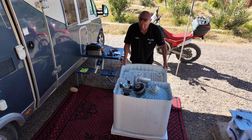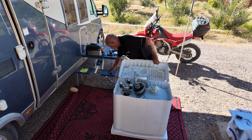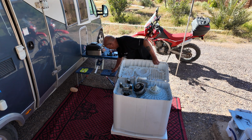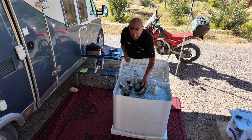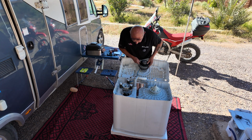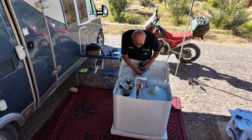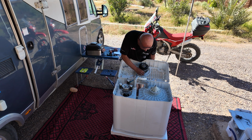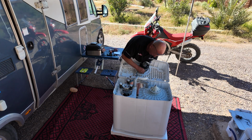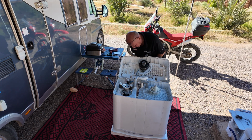Okay, the first thing we want to do is reassemble the machine, and this is quite tricky, especially when you're working on your own. You'll need to get the mounts ready and the bolts, and I suggest keeping the actual base of the machine here, then lifting up the main wash motor and just getting the one pad under, drop down the bolt, and then on the other side just get the bolt on, which is easier said than done.